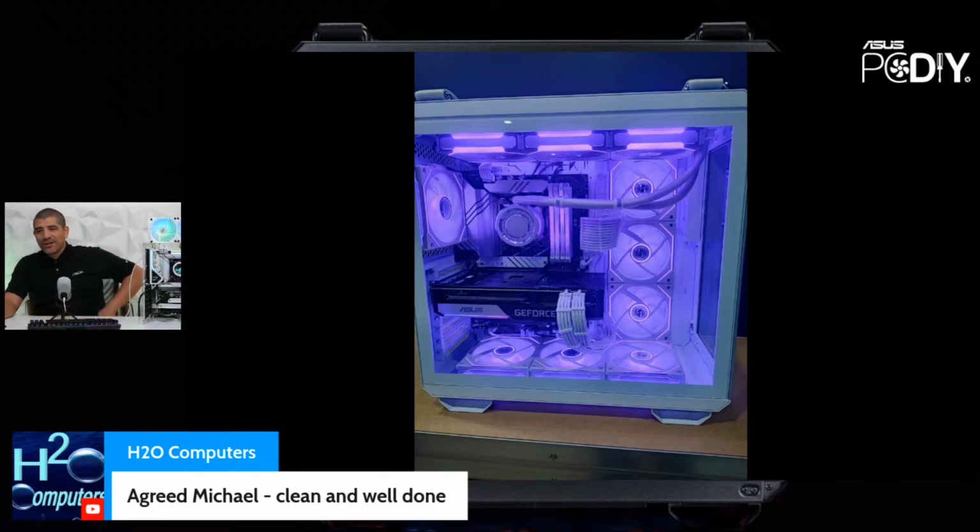In terms of the core hardware, it looks like they were definitely trying to hit a balance in terms of performance to cost, right? And not trying to go crazy in any one direction. And I think the specification here is a really nice balance. So it's a 13600K. We then have a Z790 Prime D4, so that's the DDR4 version. So that's a very solid board. That's actually the board below this model right here. I think they're actually using the P that we have there, right?